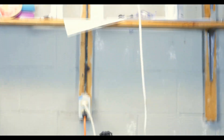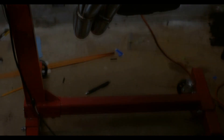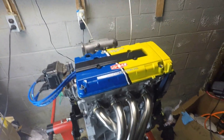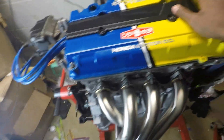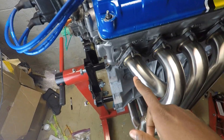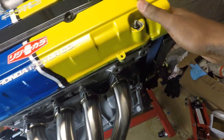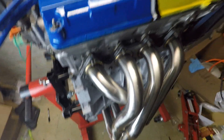Let's start with the Poor Man's Type R because that's what I know more about. The Poor Man's Type R has a B18C block with a B16 head, Type R internals, and high compression. If you want to learn more, check out the 'What is a Poor Man's Type R engine?' video. Comparing stock versus stock, I feel like the Poor Man's Type R is going to be more reliable because it's an engine that's closer to stock — it came from the factory that way. It also has a higher rod-to-stroke ratio, which can make an engine run more reliably and avoid bottom end problems.